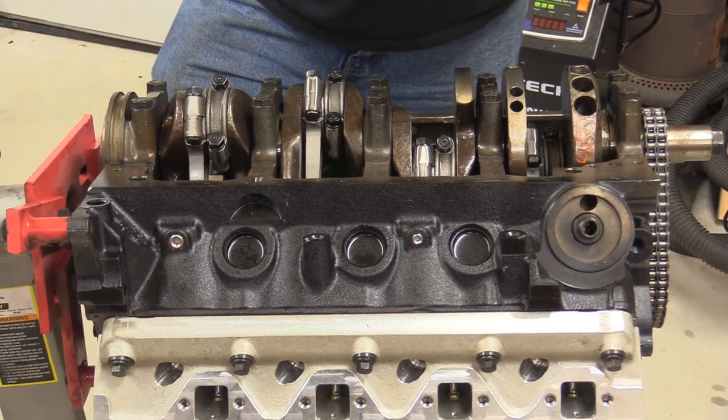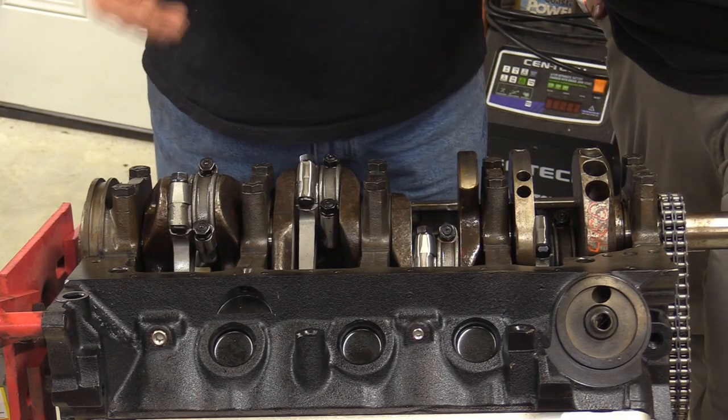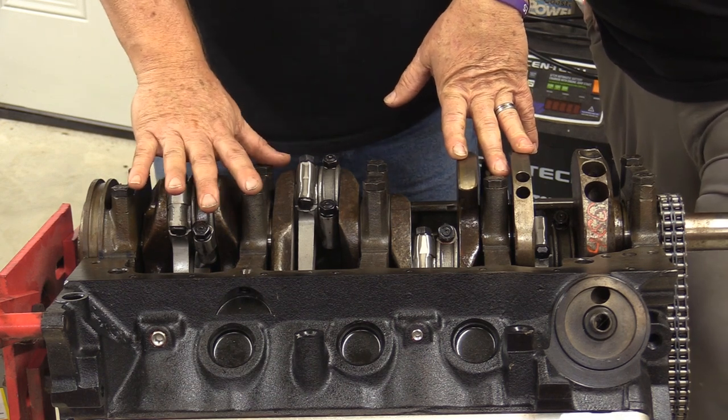We're going to talk about a couple of other small things on this. I'm going to pull Cam in here in just a second, and we're going to talk about whether you should or shouldn't do things on the bottom end of your Ford small block. One of the things we're going to talk about right now is the windage tray. Cam, windage tray. Now, yes, we're potentially running a supercharger on this engine still. That's where I really want to go. The cam is set up for a supercharger. The compression ratio is supercharger-level compression ratio. We're down around 8.5 or 9 to 1. So a supercharger is a good idea. It's always a good idea.